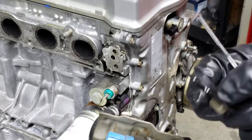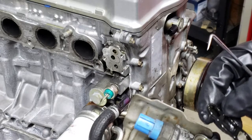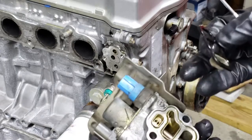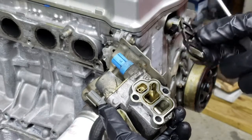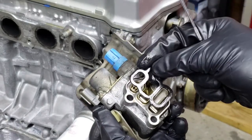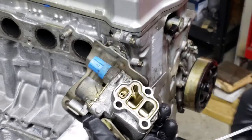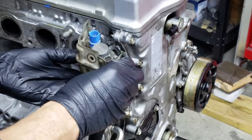There's also a little mesh filter screen in there. Another reason I bought a full head gasket kit is because it came with all these little seals. It's nothing but popping a new one in and getting it bolted up. You can see just how flat the old o-ring is — it's supposed to be nice and round. Just take a peek, pull it out, and pop the new one in.